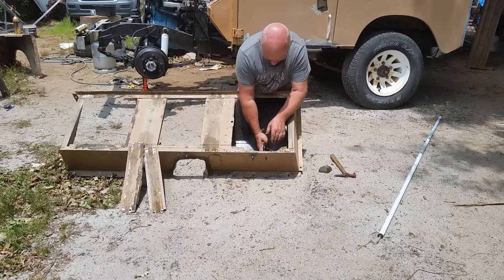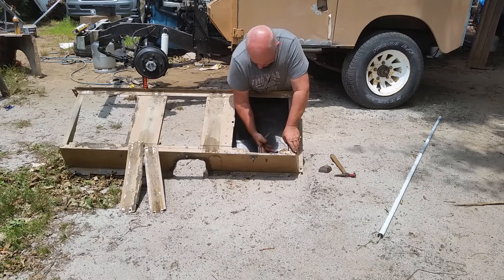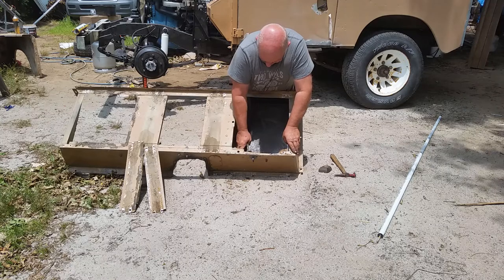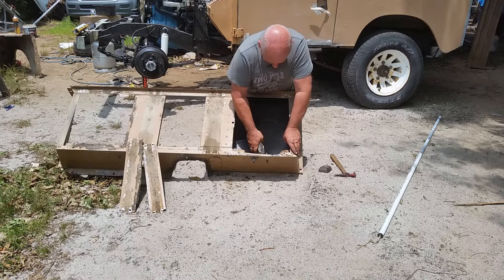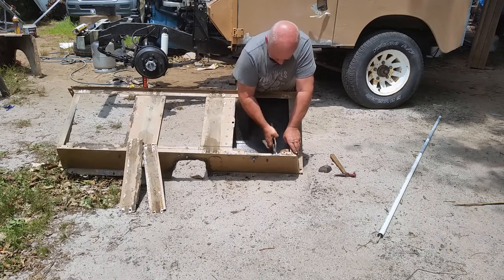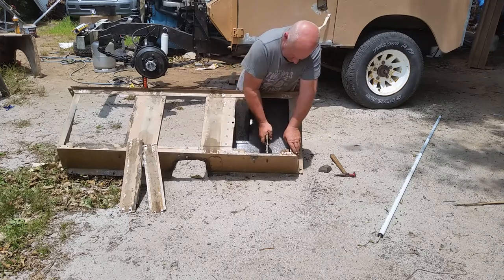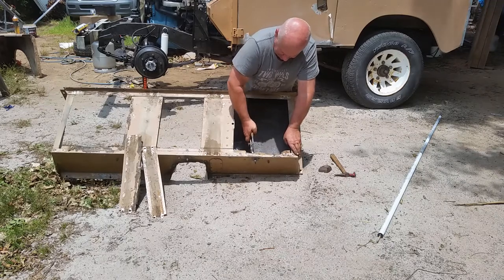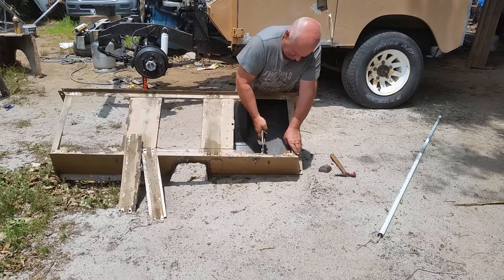So here I am back on Land Rover Beach, just attending now to random minor little things. I've done so much of the major work that I can spend a bit of time on smaller things. This is the seat box — it forms an integral part of the floor and is the cause for an awful lot of vibrations and rattles, so I'll be making sure that everything's aligned and tight and well screwed down with plenty of that dum-dum around the seams.